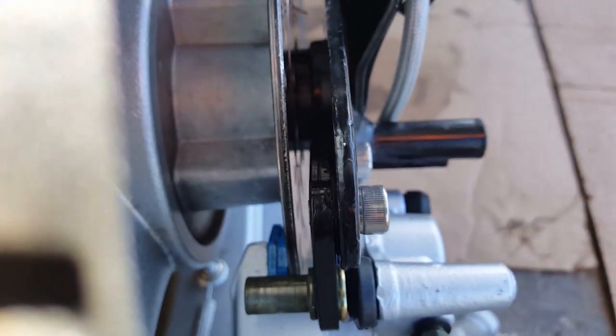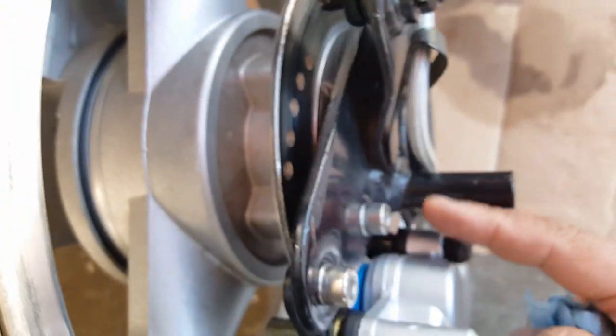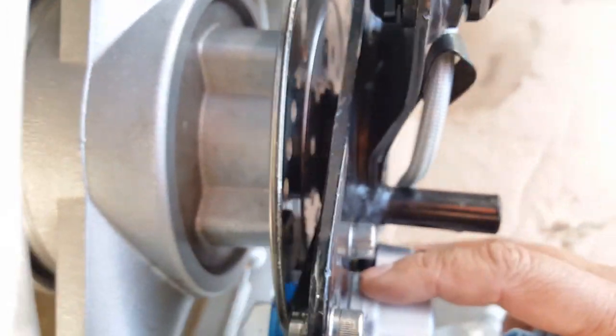And once it gets tighter, see, our brake that we just reinstalled, the piston's not even protruding out right now because it's not building enough pressure for the liquid to actually pump these pistons. Remember the two brake pistons here that we squished in? These things would show a little bit more. And you'll see that the brake pads will start gripping the disc. You'll see this actually moves because it's already gripping the disc brakes, but right now it's not building enough pressure for it to do that.